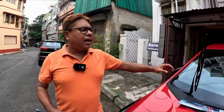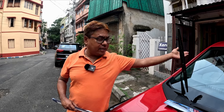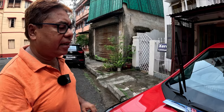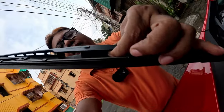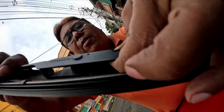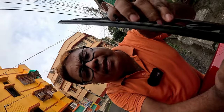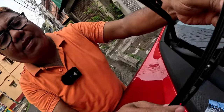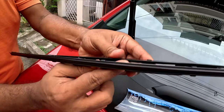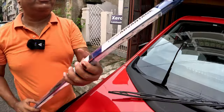So let's install them. It's been three years since we changed, so it's been hard now. Our car is in the shade, which is why we still have some life left, but in two years we have to change it. So how to change it? Here you see there is a lock — I will press this lock and just bring the wiper down. Very easy. And the wiper is released from the frame. Here is the lock, you just press it and bring it down.